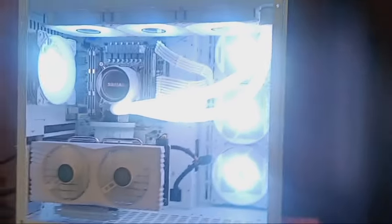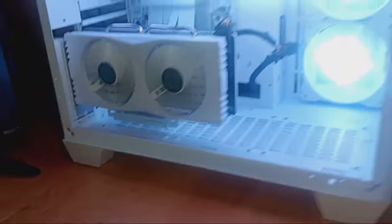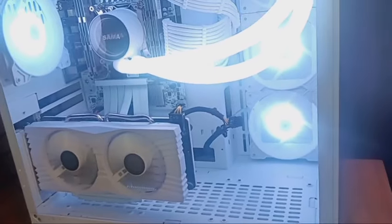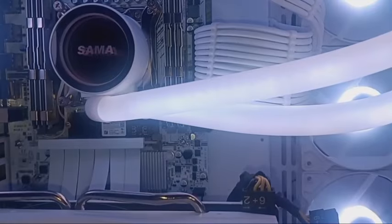I think it looks so good. I'm still waiting on the actual bracket for this. I guess now I'm going to have to go through and troubleshoot. I can try to swap out some RAM - normally it would be beeping if it had a RAM fault or CPU fault. I don't know what's going on with why it's not outputting video.